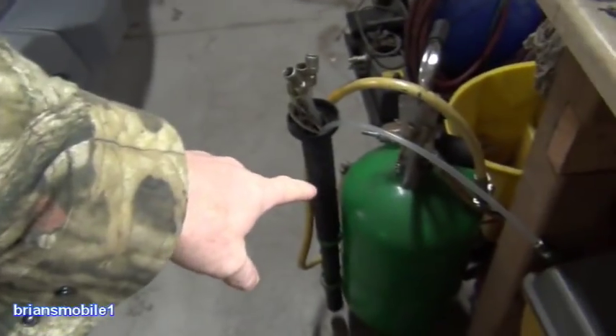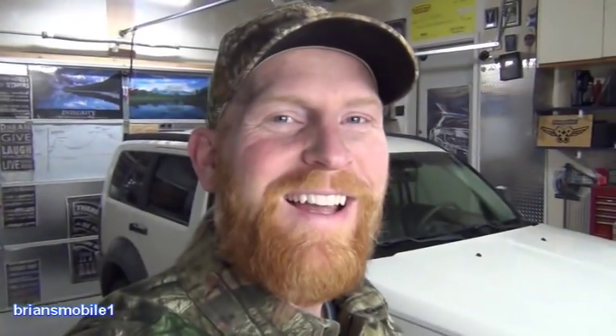When I borrowed it, he said, 'I know you're a mechanic — if you could diagnose this for me, it tends to cut out a little bit. When I start it up it revs up, then down, then up, then down.' So I'm thinking vacuum leak, fuel restriction, all that kind of stuff. But you don't know until you do something about it. So let's probe the tank on that and show you this device in action diagnosing something.